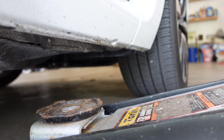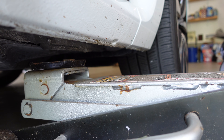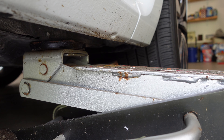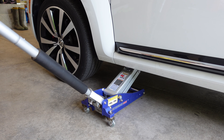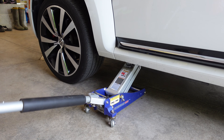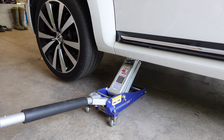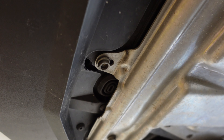I'm also going to use two floor jacks to lift the front end of the Beetle up. The first thing I'm going to do is pull off this engine cover — it just pops up. You can see the little tabs where they enter into the cover; there are four total. While I'm here I'm going to remove the oil fill cap and just set it to the side.